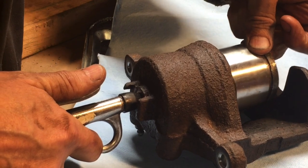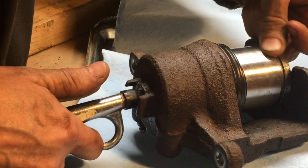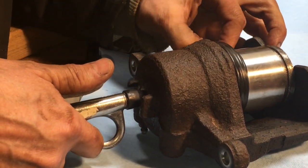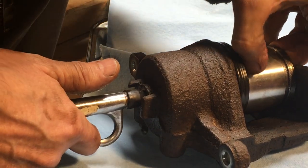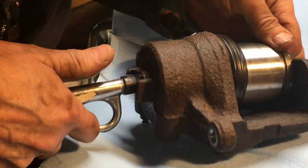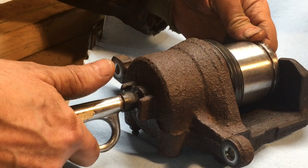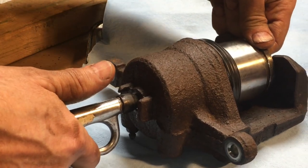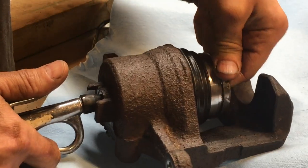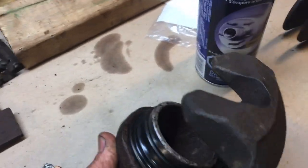Let it come to the back side of the caliper slowly. Just enough pressure to keep it inflated but not enough to blow it — it's tricky. That's it — it's seated. Keep some pressure on it and then push the piston against the caliper, twisting it as you release the pressure. And it's all seated.